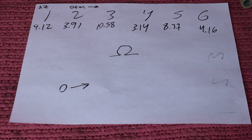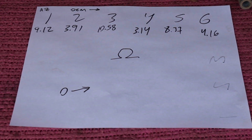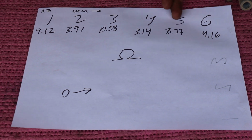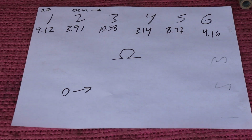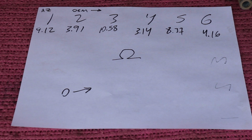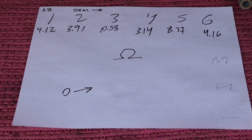Now, I logged all the data here and just numbered them from cylinders 1 through 6. 1, 3, and 5 are on the passenger side, so that means the wires are longer. So it kind of makes sense that the resistance numbers are bigger, because the longer the wire, the higher the resistance is, if you guys took physics class before. Shorter ones, 2, 4, and 6, all are around 3 and 4. Makes sense, because they are shorter.